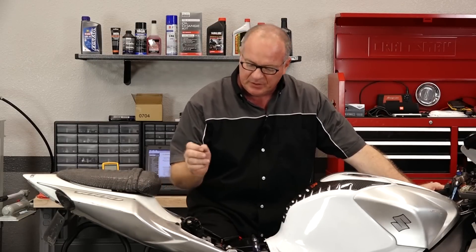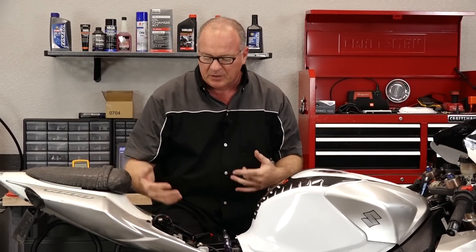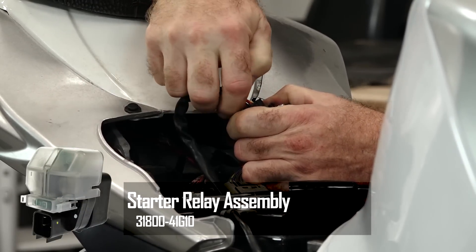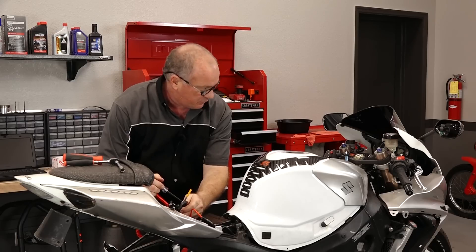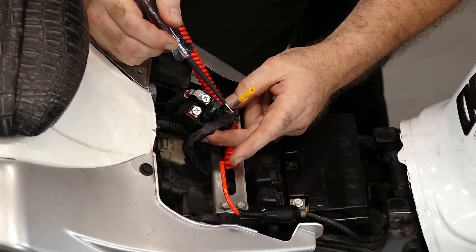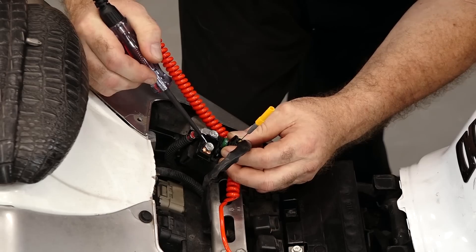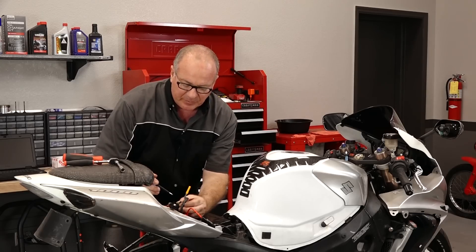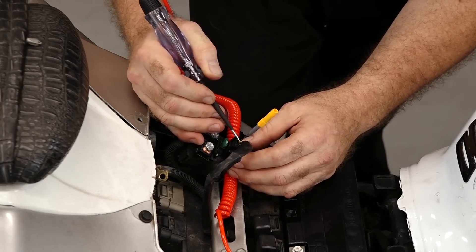Sometimes it's not so simple. So what do you do next? You've checked your battery, it's good to go. You turn it on, it lights up like it's supposed to, but you hit the switch and it's still not kicking it over. We want to actually check the operation of our starter relay — it's an item that can fail and I'm going to show you how to test it. We want to see power transmitted when I push the start button on the yellow and green wire. What you want to listen for is the actual relay to click, because it's going to energize and bring up a contactor which is going to basically connect the battery wire with the wire heading down to the starter. I've disconnected that wire so the bike doesn't start — I want you to be able to hear the relay. We're going to watch the test light light up on that yellow wire and then you're going to hear it actually engage the starter relay.